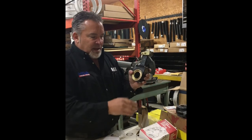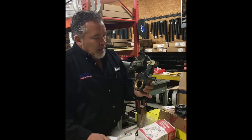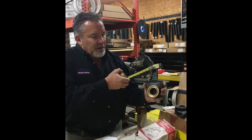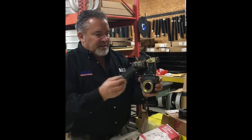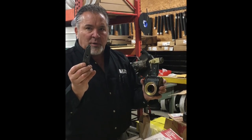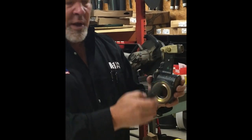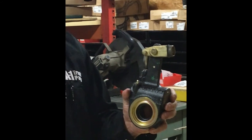One other thing you're going to want to ask them: there are all different types of automatic slacks. If you have a clevis pin here for your locking paw, you're going to want to know what clevis it has on it. This clevis here is different than this one — this one is made by Meritor, used on Rockwell slacks, and the pin placement is farther apart. Don't get that mixed up with what you're trying to do, because you will set your brakes up and they will not adjust properly.